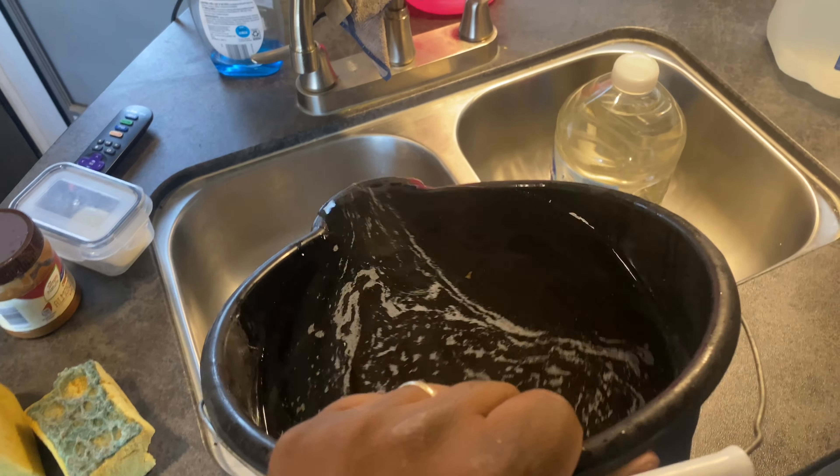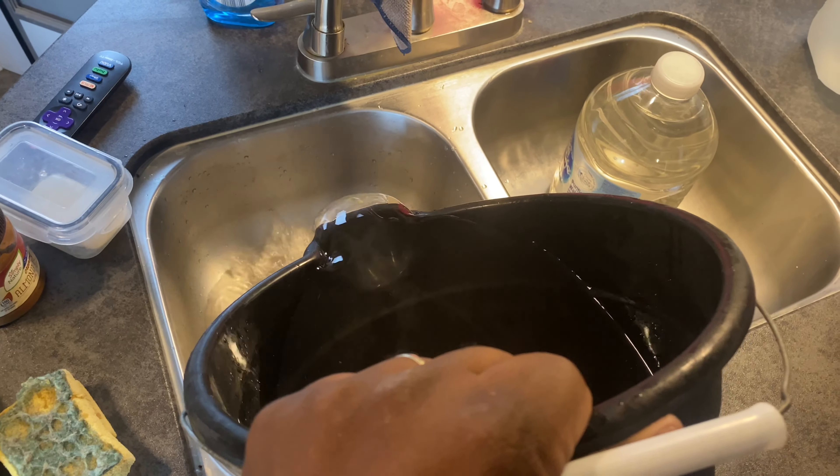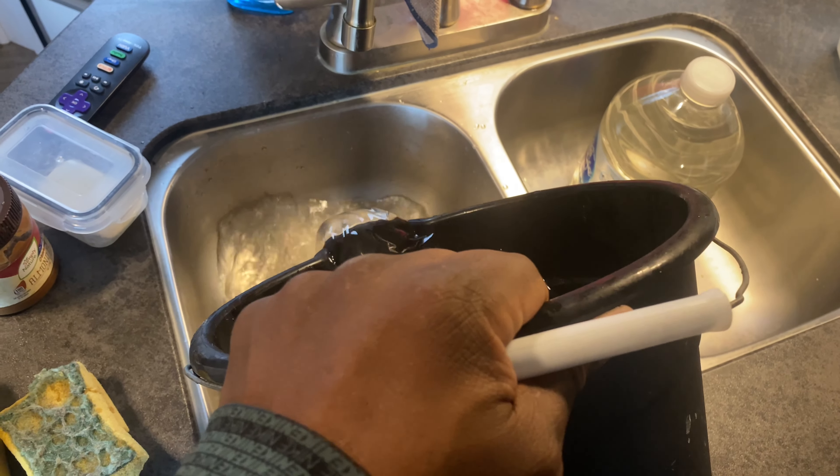It would just drip right out. We dump this water into our holding tank, which is already open because we're emptying out and leaving — so this water goes right into the drain. While you're draining water from the underside of your RV, you can open up the area where you have your hot water heater just to let some cool air inside, so when you alleviate the pressure from your hot water tank and heating element, it won't splash you.